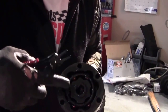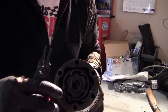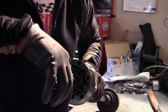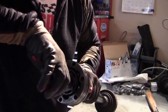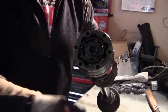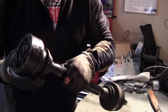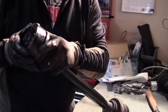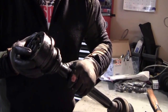The next thing we want to do is take off the snap ring. There's a snap ring that holds this axle shaft onto the bearing. Get a nice little set of snap ring pliers — you can get these at Harbor Freight or Sears. Reach in here and pull the snap ring off like that. On one side of my car it was really difficult to get this bearing off. We're going to probably chisel this flange back off here too — I've already pre-done that to make this video a little easier. This bearing came off nice and easy; the other side was a bit of a pain and I had to hammer it off.